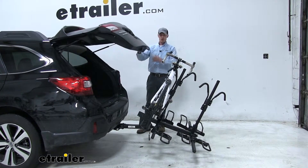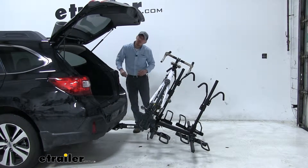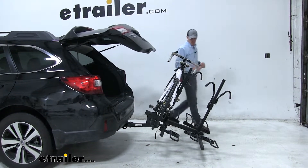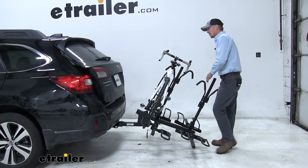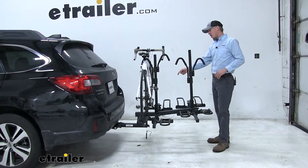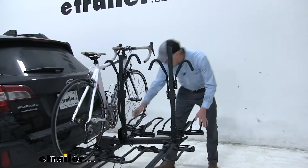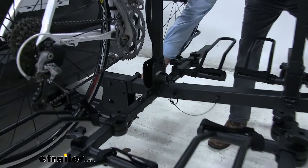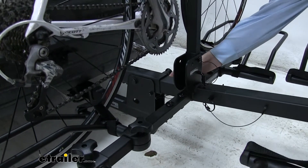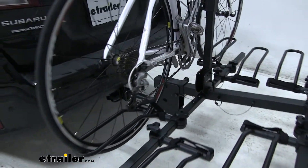As you can see, we're going to have more than enough room to access our gear. Go ahead and close that back up. To pick it back up, just raise it — it may be heavy, so get a second set of hands if you need to. That quick release pin is going to auto engage, allowing it to rest in place. Don't forget to replace that snapper pin; lifting up on it slightly allows that to go back in place. Clip it, and we're all set.